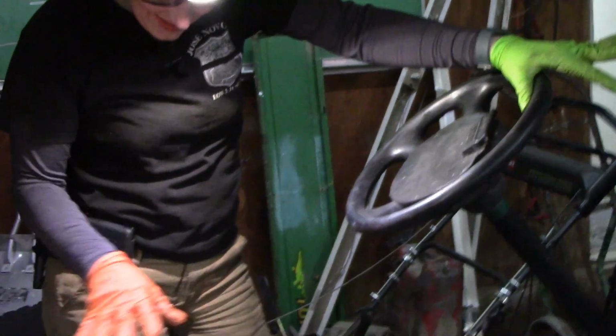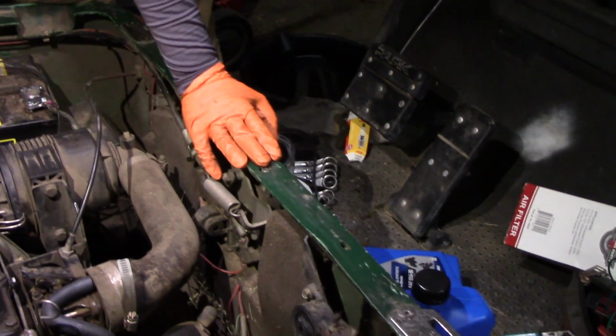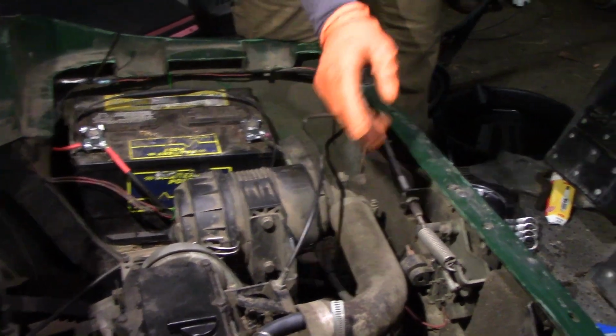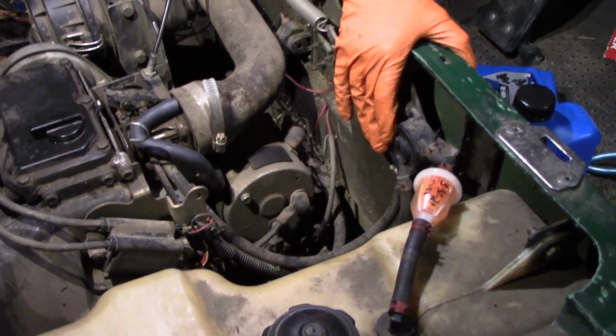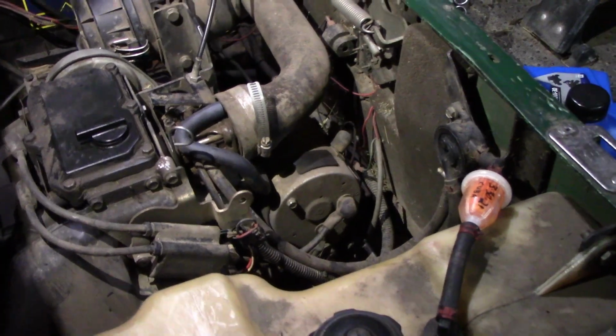We just got done zipping up the oil change. I just started up to see how it was doing. Key is on, toggle switch. And what I want you to see is, first part of the throttle pedal, accelerator pedal, is going to be the generator part, the electric part of it. And if I go further down, you'll see the combustion engine start running, and the fuel flowing through the fuel filter, which means that the pump is working, and wheels are spinning, brakes work. So I just wanted to show this part after we're all done, and I think we'll be good to go.